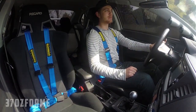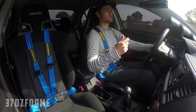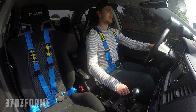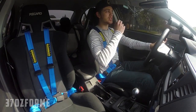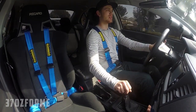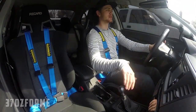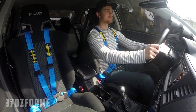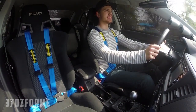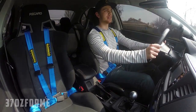I haven't had any couplers blow off. Haven't had any boost leaks or anything. The car has been really solid. I just really haven't had to do much to it to keep it running. Like I mentioned, it's time to do plugs. I just did my drivetrain fluids a couple months back, and it was about a year since I did those, so I'm still doing my yearly cycle, or every 10,000 miles or so, for the drivetrain fluids. I just did those at 5150. But aside from basic oil changes, drivetrain fluids and spark plugs, there really hasn't been anything special about the car.